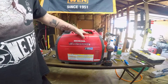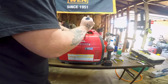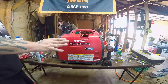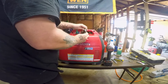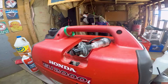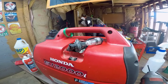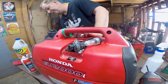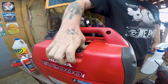What's tricky is that if this is a valve issue — this is an overhead cam, not an overhead valve — you can still adjust them, it's just a pain. So let's check for spark. I'm hoping it's a no-spark because it's probably easier to fix than a compression issue, but it could also be a fuel issue. We have the switch on, eco throttle off, and we're getting spark.